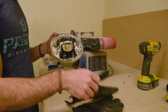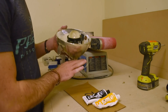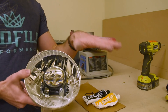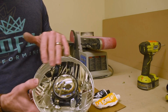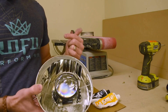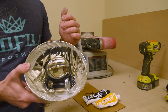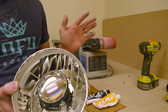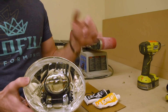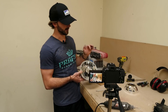The lock ring is on there and the projector is hand tight. From there we want to focus on installing the shroud. It is worth mentioning that before you put your shroud on, it's good practice to make sure there's no dust, fingerprints, or anything on the projector lens — especially on the backside of that lens. It's very frustrating when you do a retrofit, light it all up, bolt your car back together, and find fingerprints or debris on the inside of the lens. Make sure there's nothing on the inside of this lens because it's going to drive you nuts.